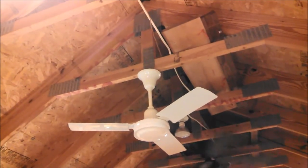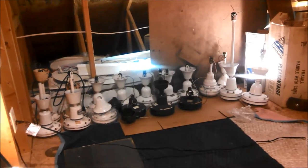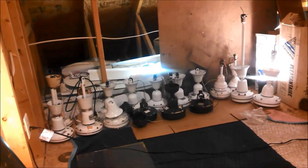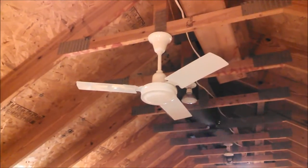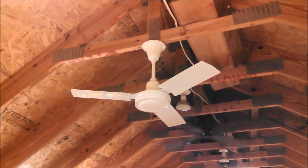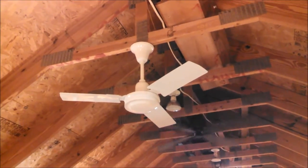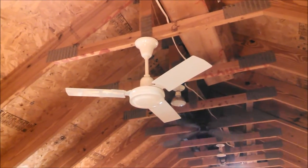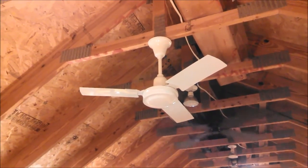The canopies are both plastic, which is odd to me. All of the Nutone versions and the steel-motored Airmaster versions all have metal canopies, but this has plastic canopies, which I've never seen before. At least I've never known that they were plastic if I've seen them before, so that's kind of odd to me. The same motor was used for all three sizes, but it appears they changed the capacitor value because there's different wattage ratings for all three sizes.